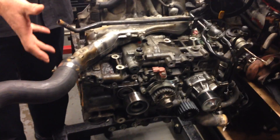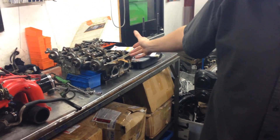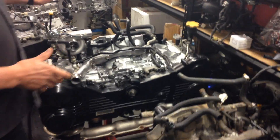Let's start off in the early days where we're talking about the EJ20 engine, and this is one in front of me here. It's come out of a 1999-2000 model STI which has got the forged pistons, 2-litre engine. What you're seeing here is the block itself without the heads, because the heads are sitting on the bench behind me, and the inlet manifold of another engine is in the middle of being rebuilt here.